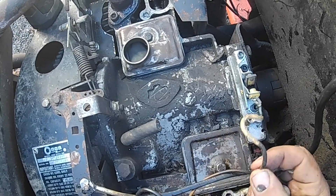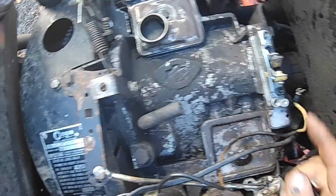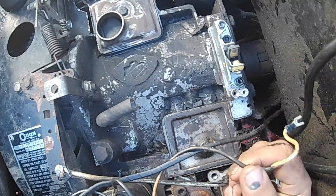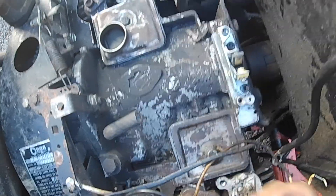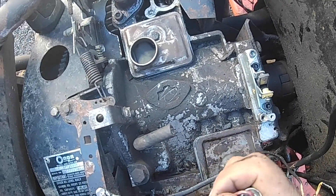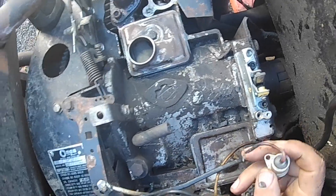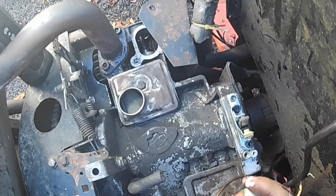You want to inspect your wire — make sure there are no breaks anywhere from one end to the other going to the coil. If there are any breaks or any exposed wire, replace it; that will give you all kinds of problems. We recommend replacing the condenser every time you do this service, and the points as well. The condenser probably needs to get replaced more so than the points.